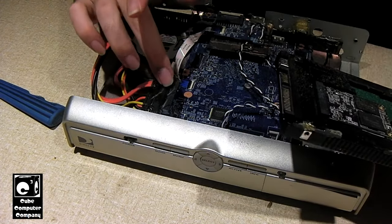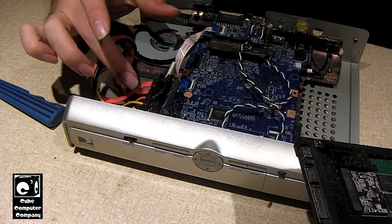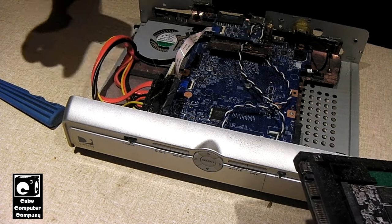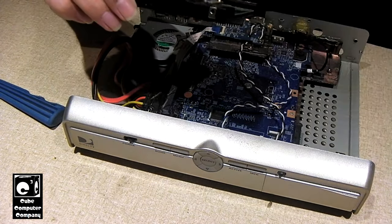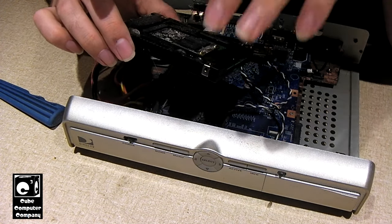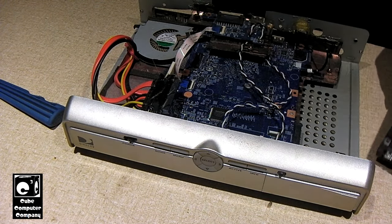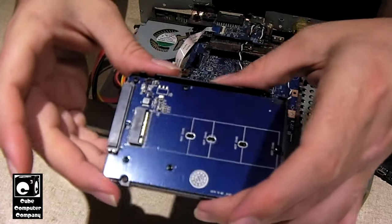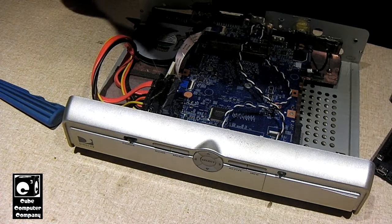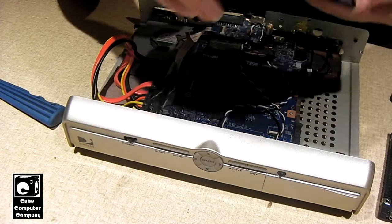Installing a replacement shouldn't be too bad. I had this little SATA bridge piece — it basically just bridges SATA power and SATA data from the motherboard connection where the hard drive used to go, so that way I can just install a hard drive or SSD up here. What I'm going to do is use an M.2 SATA to 2.5-inch adapter — it is right here. We're going to get our new SSD, still need to take it out of the Amazon package, mount it in here, and attempt to copy the stuff off the old SSD onto the new one.